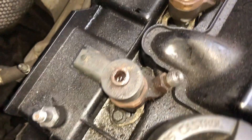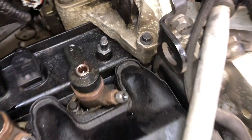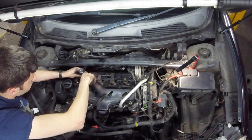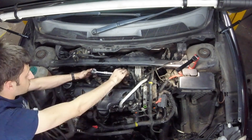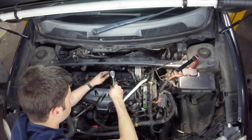The injectors are clamped down with two 8mm bolts each — loosen and remove the bolts. You might need a thin wall extended socket for this as it's quite close to the cover to squeeze the socket down next to the injector.